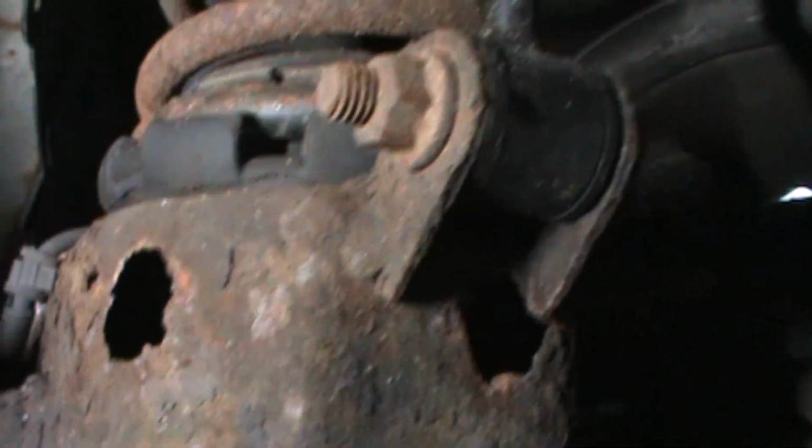So, all in all, what's the moral of the story? The moral is, check the front end. Don't check it just one way. Don't stick to traditional, "I'll just shake it and it's good." I'll put a screwdriver. Check it all the different ways. Load it, unload it, squeeze it with a pair of channel locks. And yes, I did see the rust before I checked the other stuff.